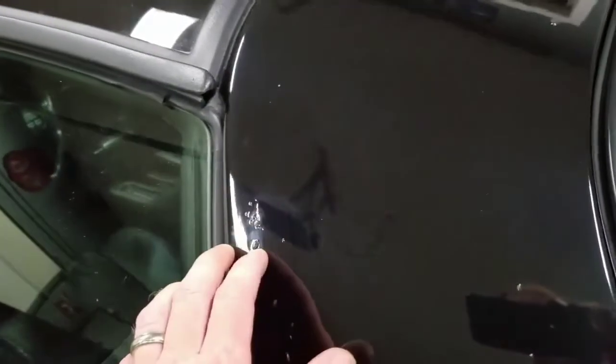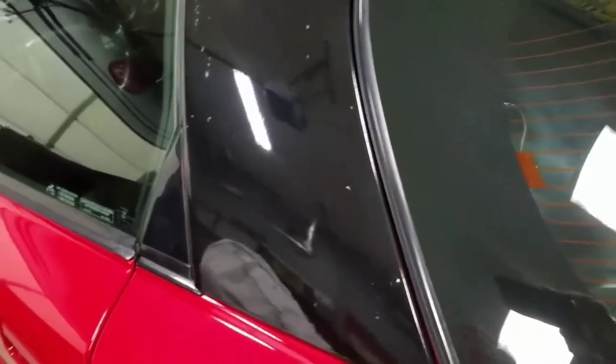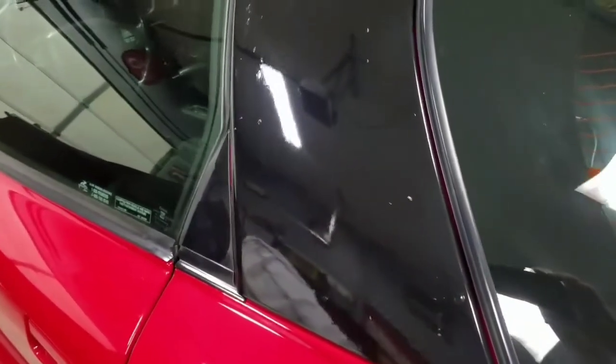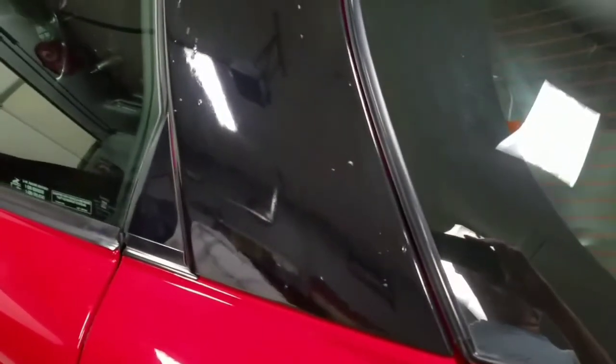The whole issue with this is GM stopped epoxy coating the bottom side of these. So that allows the urethane to seep through. That's where it's glued down. So the best way to fix this, obviously, is to peel the old panel off and get a panel that didn't have that issue, which runs 93 to early 99 models. I would try to stay away from a 99 model because you have no idea when it was made, but try to stay 93 to 98.